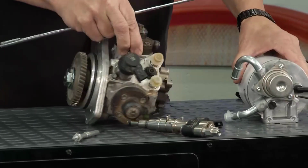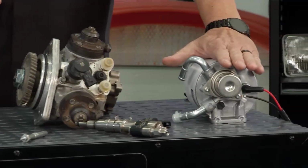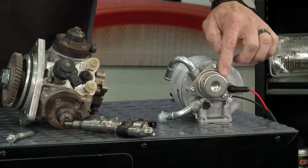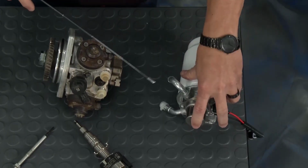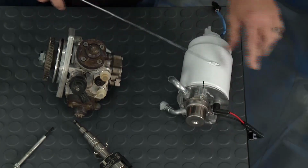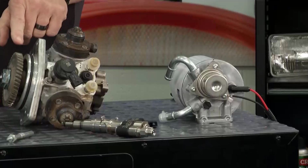Now before that, right here is our fuel separator. So anytime I introduce air into the system, this guy here is going to start losing its prime, and I got a pump on the top. Boom, boom, boom, the air separator, pump, pump, pump to get it to this point. Then what we do, we inject it right here.